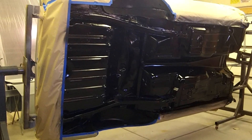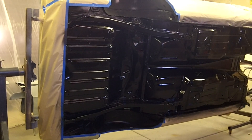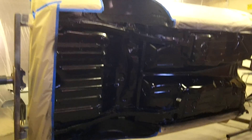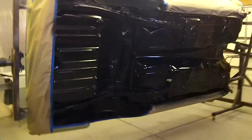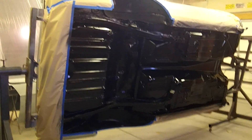What I probably ought to do is see if I can put a rear end together for it. I really want to put a 12 bolt in it but I can't find one at the moment, so I may just go ahead and put the factory 10 bolt back under it with a set of gears and a posi in it. I'm kind of over the whole drag racing thing — I've done that most of my life — and now I just want stuff to drive, so I'm not too worried about breaking it. I might do a 3.73 rear end just so the car's peppy and fun to drive. I even thought about making an adapter to put a 12 bolt cover on the 10 bolt rear end just for the look. I mean, this car is a total clone anyhow — a low horsepower 350 car, not a real Yenko. It'll never be sold as a real Yenko; it's just a look-alike, a wannabe, a clone — whatever you want to call it. But I'd like it to look like one.